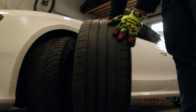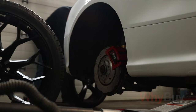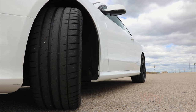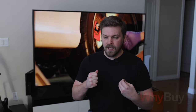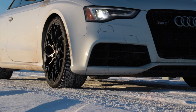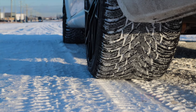Look at the tread difference — just an exaggerated comparison between a summer tire and a winter tire. You can see the tread design is not only different, but there's a lot more going on when you pay close attention. Summer tires tend to be a lot more flush in their design — they want a high contact patch and there isn't much concern for loose debris. The magic with summer tires is really the rubber compound. But juxtapose that to a winter tire, which is way more extreme in tread design — much deeper channels, and also these tiny little slats at the top of the tire.